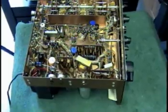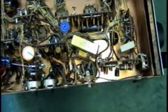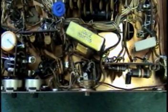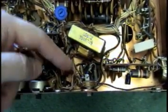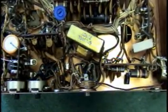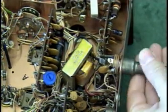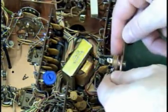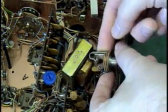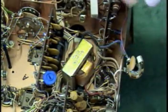The first step is to remove your covers, flip your R4 receiver upside down, and then we need to get access to the filter cap, which is hidden under this jack here and right next to this transformer. You see a bunch of wires, but don't let that intimidate you — it's really not that bad to get to. So let's get this headphone jack removed, spin the knob off, and flip it out of the way so you can get access to that filter cap.